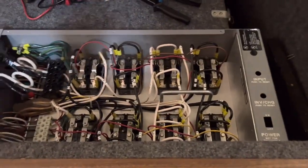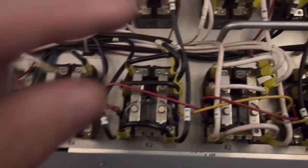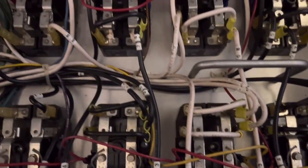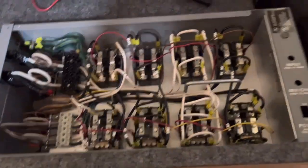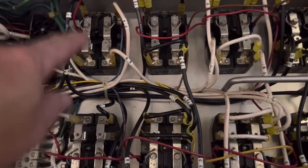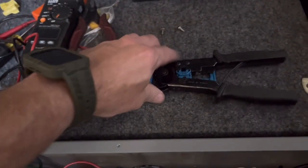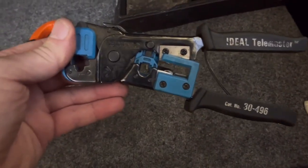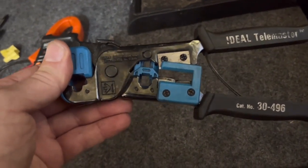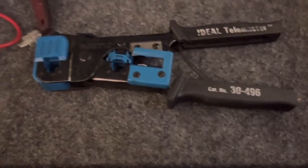So that's all good. Now we can button this guy up, put the lid on it, and put this other cover on it. Like I said, what we did was basically retrofit a newer inverter charger back in the same case of this original inverter charger. We'll put that cover back on the top too — close all this up, since this is all 120-volt and we don't want that exposed. This is my little crimper tool — I had to run and get RJ11 telephone jacks, cut the ends off, and remake the RJ11s. That's available at the home improvement store, not too expensive.